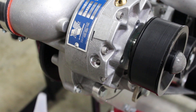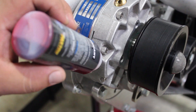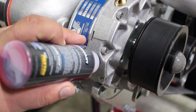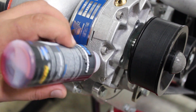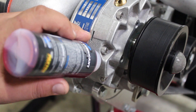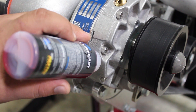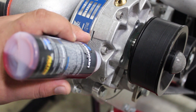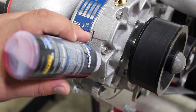Now that you have your oil ready to go, place it into the hole of the gear case where your dipstick would normally go and lightly squeeze it in, making sure not to spill any oil. It's going to take a few minutes, but make sure you get the whole bottle in there. Usually one full bottle of oil equals one oil change, so drain this bottle into the gear case and it should be enough fluid to keep the Supercharger safe.